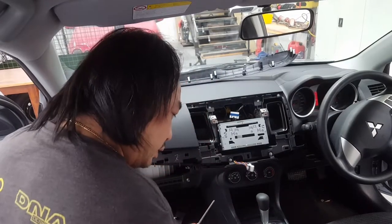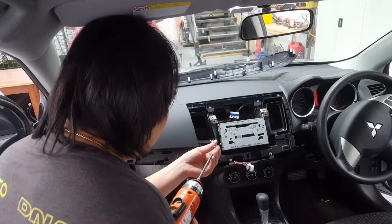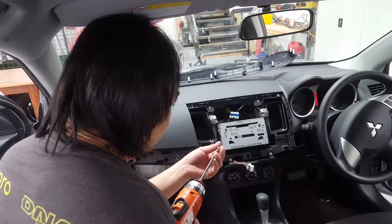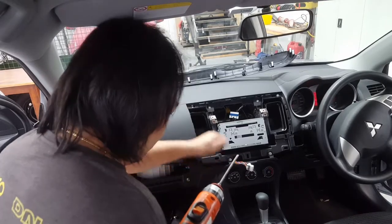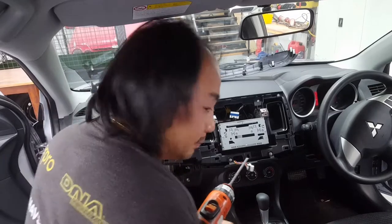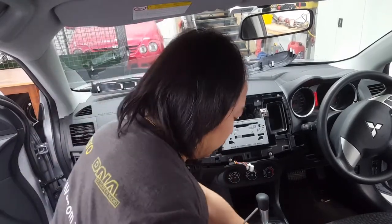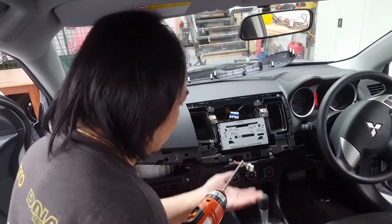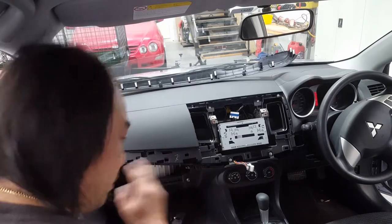The thing with this is if you're using a drill or so, sometimes the screws have a tendency to be a bit worn and it will strip off. If you grab another screwdriver and strike it forward on the thing, it becomes magnetic, so it stops the screws from pulling off. Here's one, like that. So, hold on, I'm going to pause it and be right back.